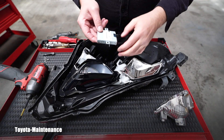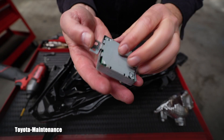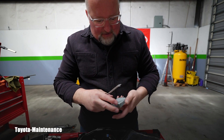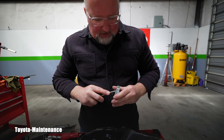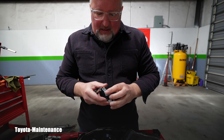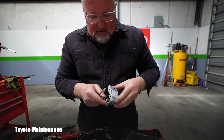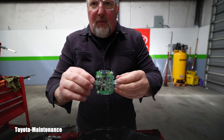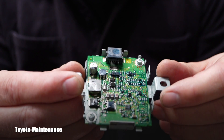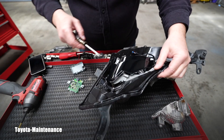Everything has a nice little connector. You can see this ballast computer right here — look at how wet it all is. Let's turn attention to this little computer because I think I can open it. I see it's snapped on top. Look at that — sure enough, that poor thing is soaked with water. There's a possibility that this was the reason for the flickering.